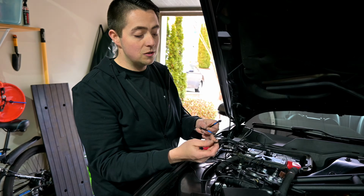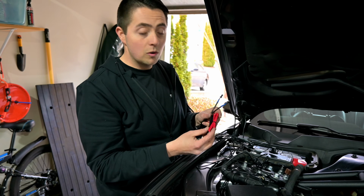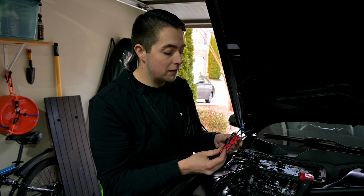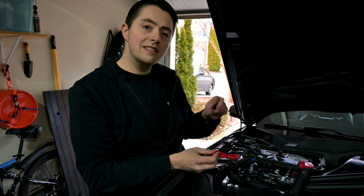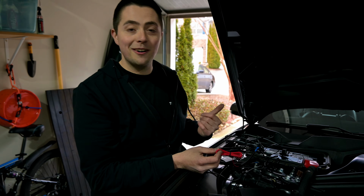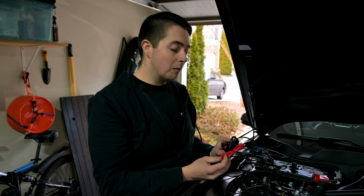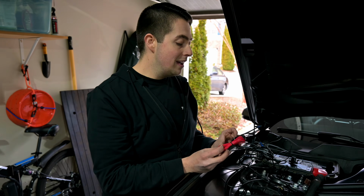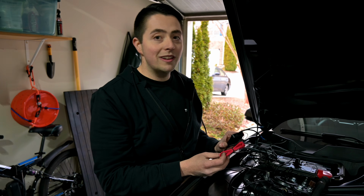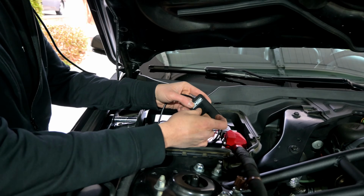Hook up the last 2 cables that you have from those LEDs, and if you want to use the door assist function, you'd wire these into the dome light of your vehicle, and this would allow for, basically, when you open the door, it would send a signal to the box saying turn on the lights. So it's kind of a cool feature. If you'd like that option, you can route these 2 wires. We're not going to do that today in this specific video. However, if you want more support, please contact OPT-7 directly, and they'll be more than happy to give you support and install instructions of how to do that for your specific car.